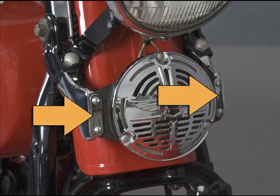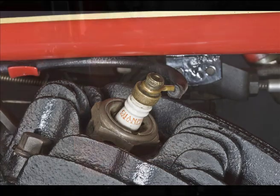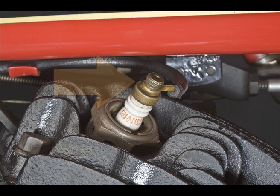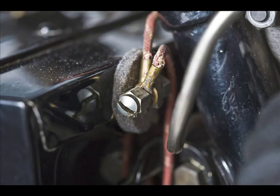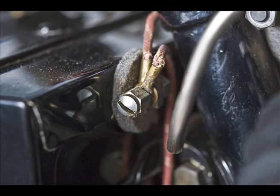The little plates on the front of the mounting kit are chromed as a 1 year feature, and note the round-headed cadmium screws for mounting. No deductions. On the spark plugs, note the cotton-covered leads with the little hooks on the end, and the owner is showing off here by using some original 1 3/8 AF Harley spark plugs. Fabulous. On the battery box, we can see the cheaters that simulate the look of the terminals on the original battery.